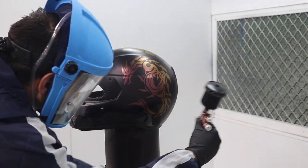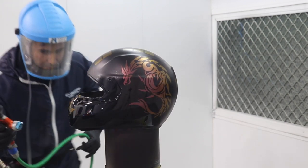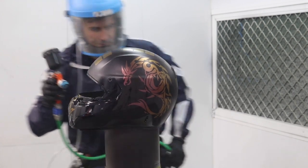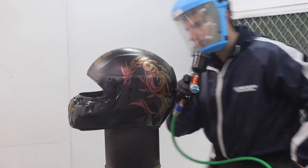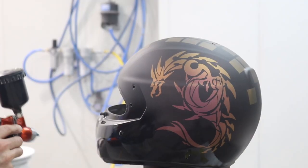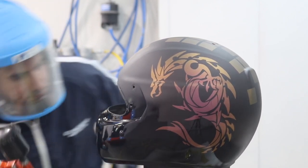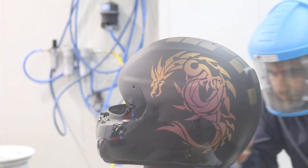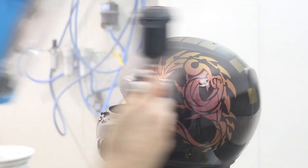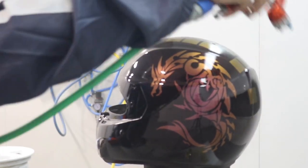This is two pack, which means it's going to be solvent resistant. There's two parts to it, a clear and a hardener, and basically it goes on shiny, and when it dries it's super flat and actually looks really good. I've sprayed two coats of the flat clear. I've let it dry for about 10 minutes between coats, and this will dry probably in about 2 hours, and then I suppose leave it overnight and I can start putting it back together.